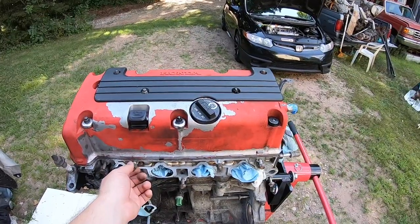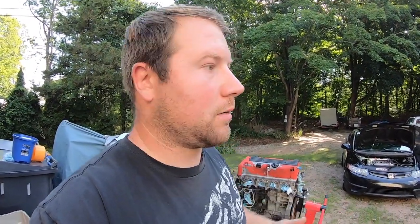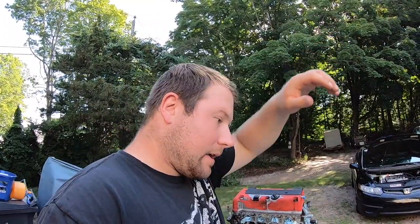Literally same identical motor, guys — same horsepower. Difference in torque, difference in parts, but the parts were so interchangeable it's unreal. I hope this video helps you guys out. Even though it's hot, I wanted to come out here and make this for you. A lot of you guys have been involved in this build and this process. The best thing I can recommend — if you're unsure what sensor is going to work, use the sensor that came with the car with the harness. Use everything from your K20 onto the K24.